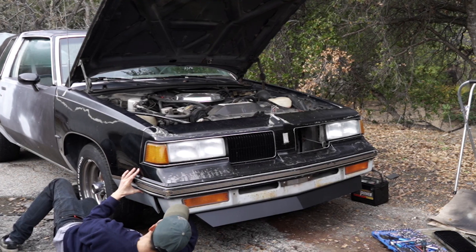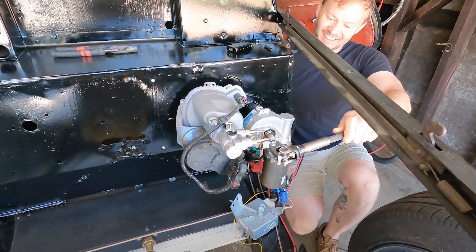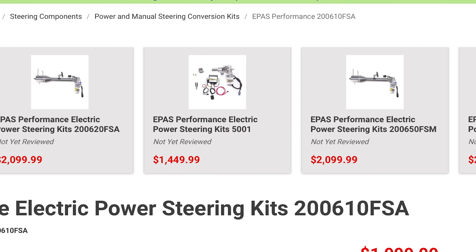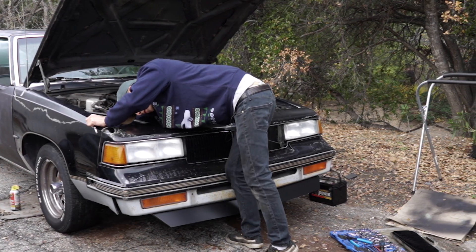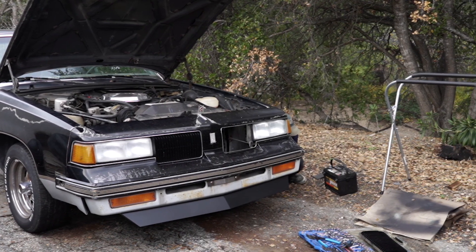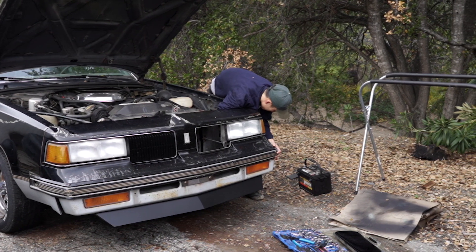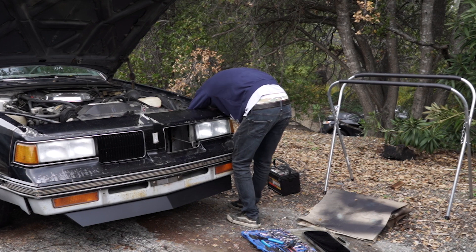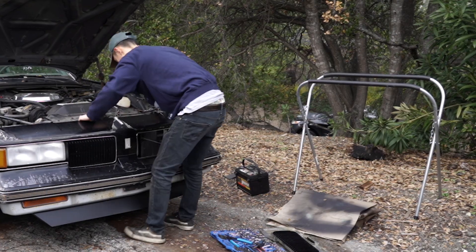There are two ways I could have run power steering on this vehicle. The first is a motor on the steering rack or steering column that assists you in steering, but installing that would require a lot of cutting, fabricating, and money. The second way — and what I'm going to do — is use an electric hydraulic pump and pump fluid into the original steering box. These 442's came with pretty good steering boxes and ratios, so I want to keep that. I also think this is the easiest way to go back to stock. Something that scares a lot of hot rodders from EV conversions is reversibility, and running an external hydraulic pump through the original steering box is the least intrusive way.